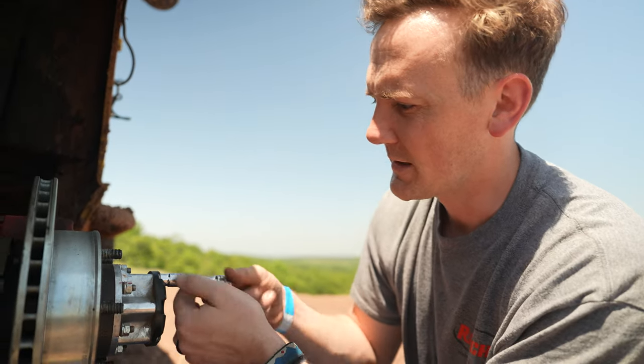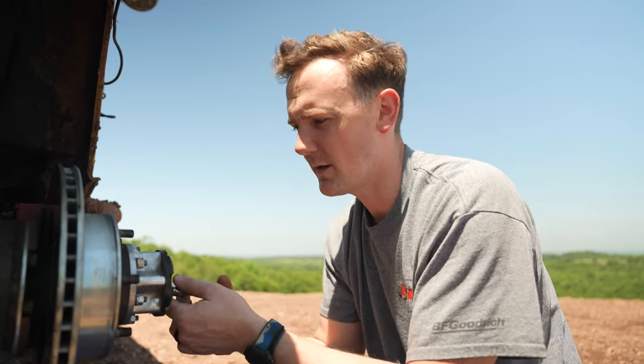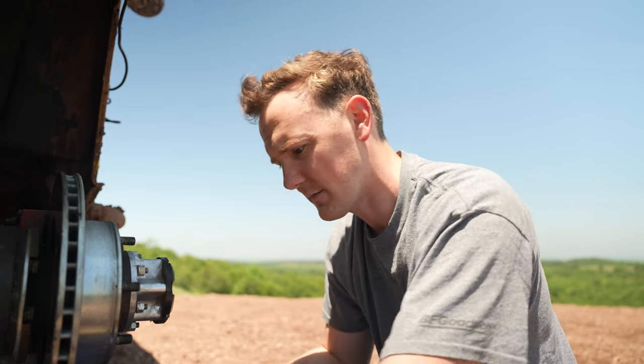So now it will be getting an upgrade. But to get to it, I need to take the hub off. I did switch to the IFS hub, and what that allows me to do is the brake rotor is not actually pressed on — it just slips on. Versus the original style, which was a hub with a press-on brake rotor. This allows us to just slide that on and off more easily. So I'm just going to start by taking the hub off, disassembling it, and trying to get to the inside so I can see what's actually broken and what needs to be fixed.